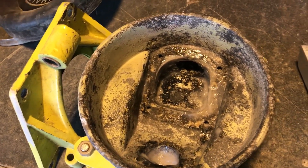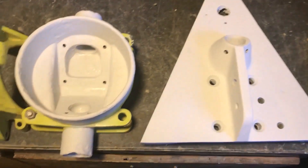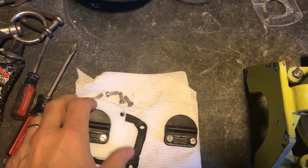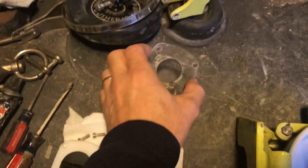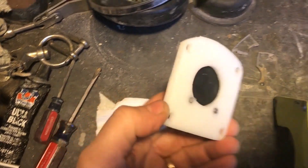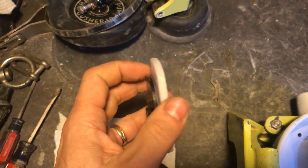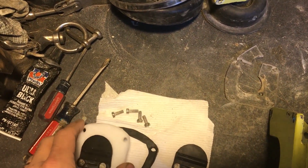Some of the pits I tried to fill in. Here are those two pieces with white bare metal primer. Also the valves for the pump — I've cleaned them up, we'll see how they work, I may have to replace them. This little piece which holds the exhaust valve for the pump is actually deformed and cracked — it came off. So I fashioned a replacement out of high density polyethylene using the old one as a template. This stuff is really durable, indestructible even, and it's a little flexible so it'll conform a little better.